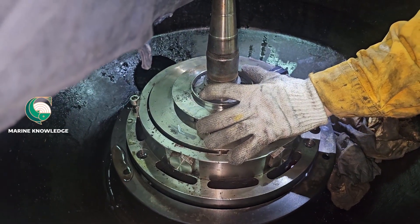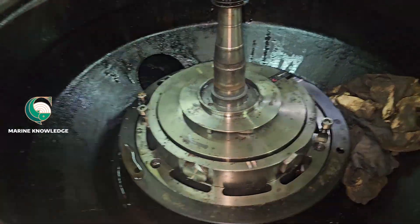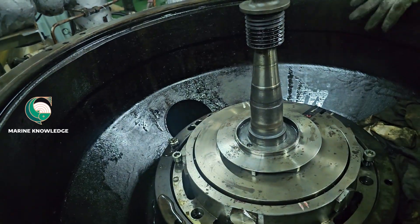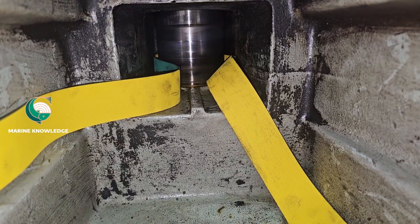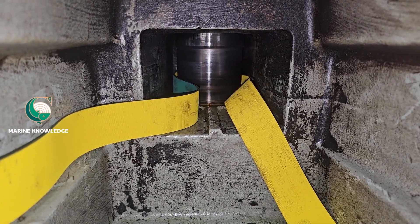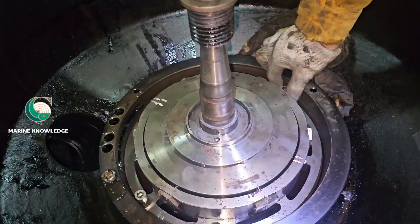You can follow the pattern of the air deflector and fit it inside the body very slowly — it has to be lowered carefully. Mainly it should not be turned; that is the main safety precaution. Be careful with your fingers as they may get cut if trapped between the body and the deflector. You can see the belt is in place and I will try to rotate it.